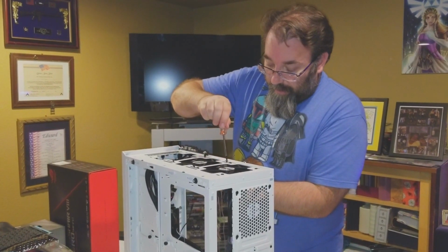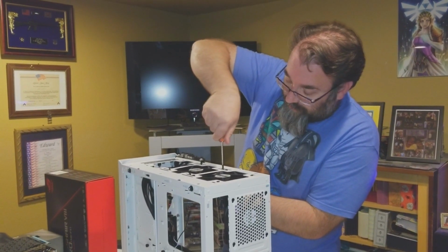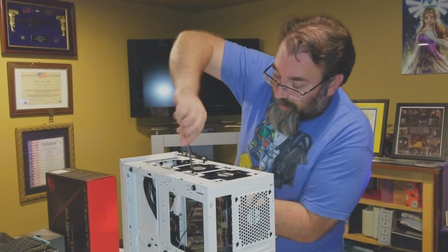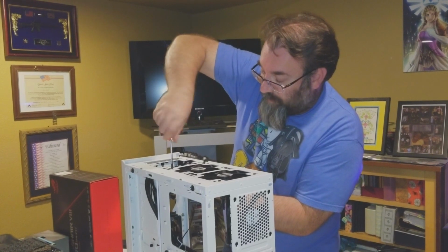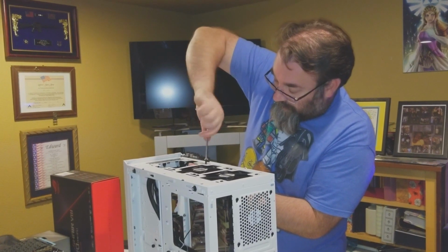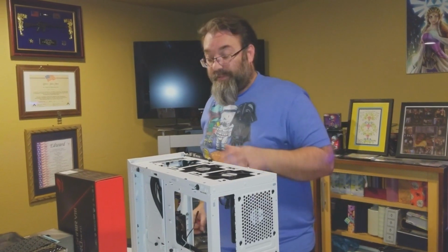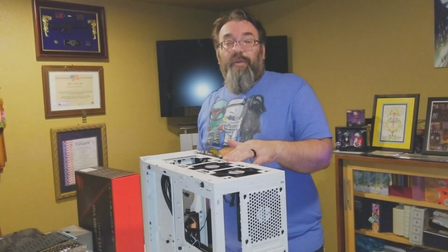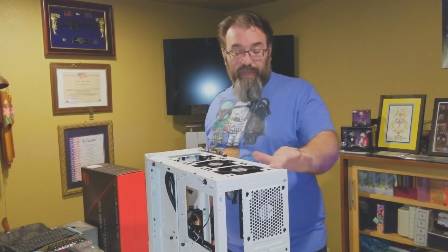One thing that I do see is going to be an issue is the wiring for the top panel here. The top of this case has your buttons, your standard power button, reset button, a couple of USB ports. It also has a K-boost button, where what that is there's some software that EVGA provides with this case that automatically overclocks your video card and supposedly your CPU. What it does, it keeps it in the P state on the video card, the performance state, so that way it doesn't downclock, it stays overclocked automatically and doesn't budge from there.